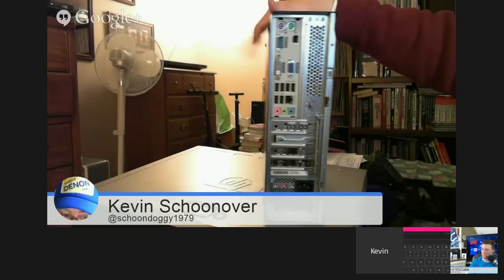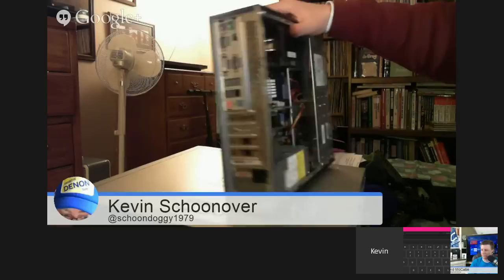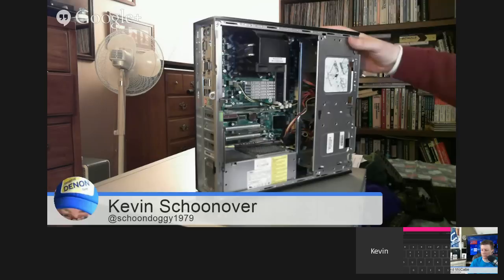I picked up a couple of Netgear pro switches, ProSafes I think they're called, and updated the code on those. They take little SFPs on the end, so I'll run fiber from here to there. Once again, I think this was a $50 box off Craigslist. Memory, 8 gigs, set me back $50, and I had a quad-core Pentium processor to pop into it. The nice part about these things is if you've got parts and pieces lying around. Like you say, our own companies are getting rid of this stuff because it doesn't do what they want, but that doesn't mean it's not useful or functioning.